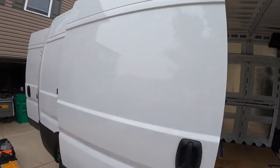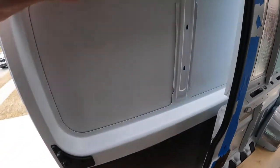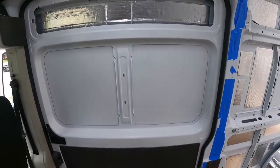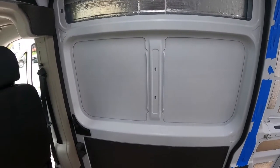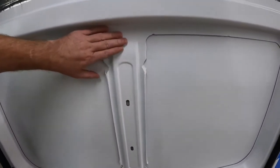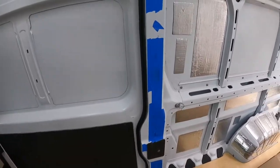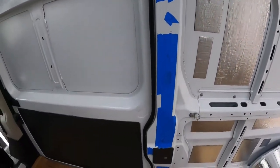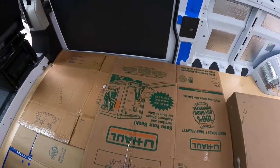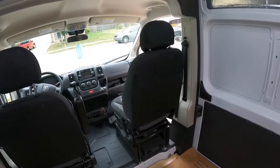We're going to be putting a window right there. That's the template inside the van that I'm talking about. One of the first things that needs to be done is I'm going to have to cut this brace out, which I'm just using a grinder for. I've taped up a few holes, make sure no metal shavings get in. I'm also going to throw down a tarp along the floor - I've already got cardboard down to protect my wood floors, and I'll probably hang something up here to protect my cab.